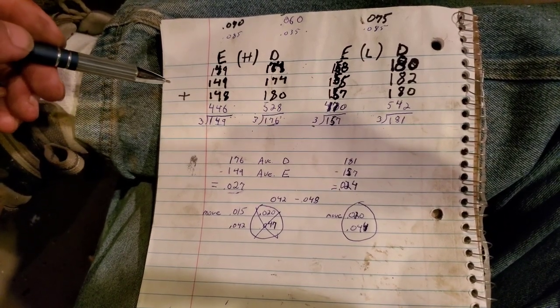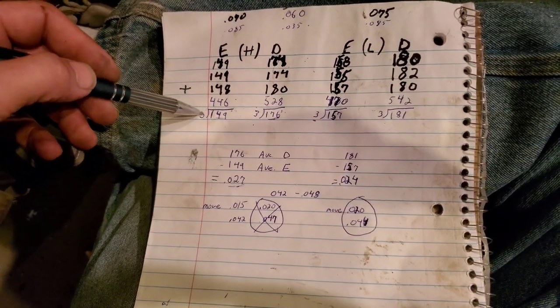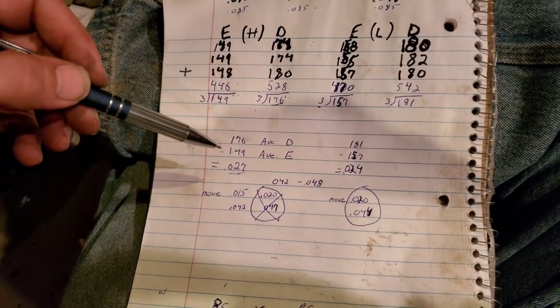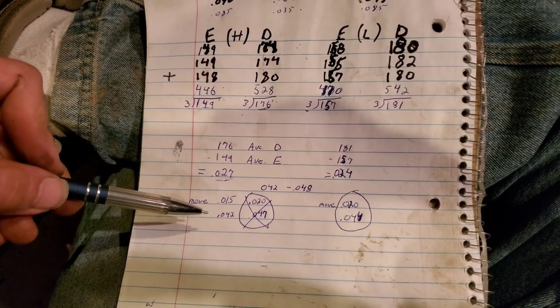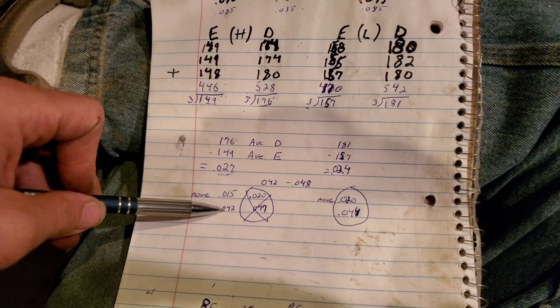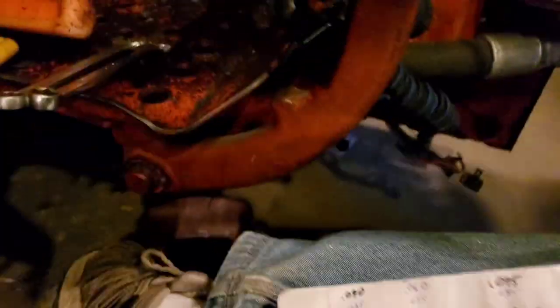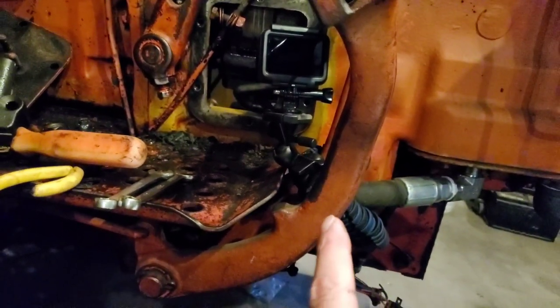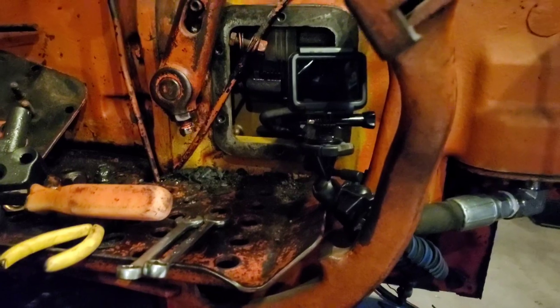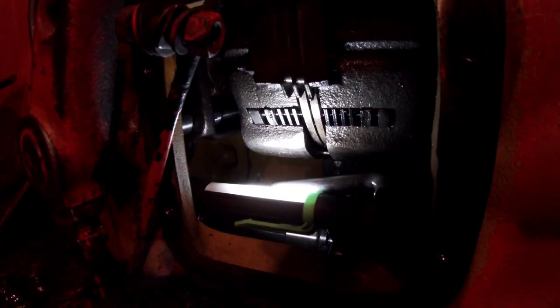This is what I'm going to be changing. On the high side, and that's what I'm going to be changing on the low side — it's going to get me right there within spec. What you're going to need for this is good half-inch wrenches. Something like a Pittsburgh from Harbor Freight is more than likely going to strip out because these are tight. Another thing that's good to have is a pry bar. I'm going to spin that down and stick the pry bar right there, and I'll just break these loose. These are the long shims.